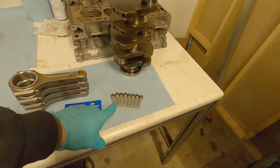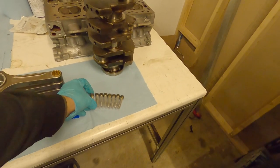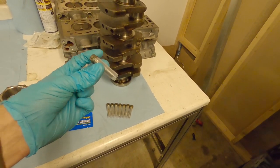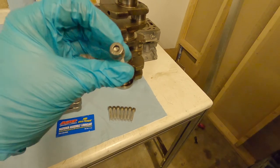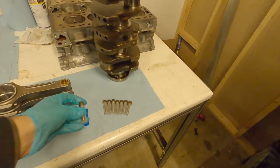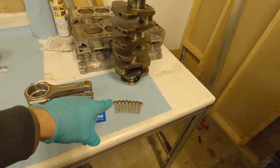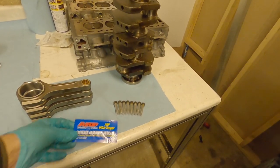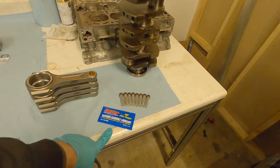ARP will probably give you a sheet with three or four torque specs on it. They normally have more than one bolt material or bolt size, so you need to measure your bolt size and determine what size it is — these are probably three eighths or seven sixteenths imperial, not in millimetres. The material type will also be written on the top of the bolt — for example, it might say ARP 2000. Once you know the bolt size and material type, look at your datasheet for the correct torque setting. Additionally, those torque settings from ARP assume you're using their lubricant. If you use engine oil, those torque settings are no longer going to be right — you need a different torque setting to get the right bolt stretch.